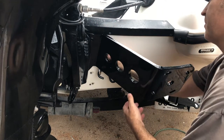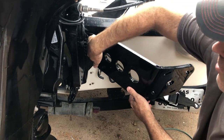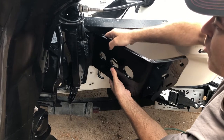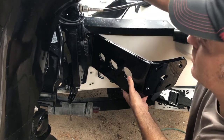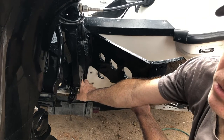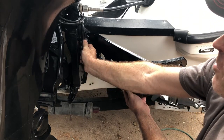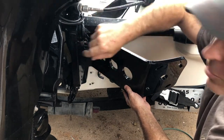This is pretty simple — I've got a transducer cable going into a hole right up here, so I've got to be careful and angle this bracket in. But once you get it in, it slides around pretty good. I'm going to run this bolt back through on the top side, put the nut on, then run the other one through and leave them both loose but snug enough to hold the motor from moving when I do the other side.